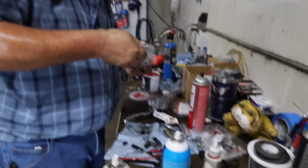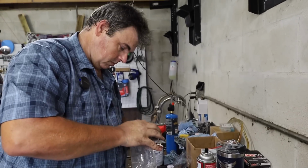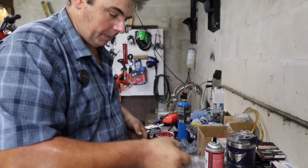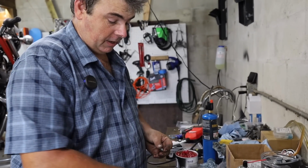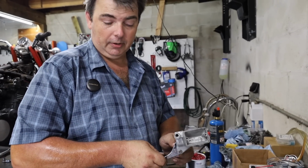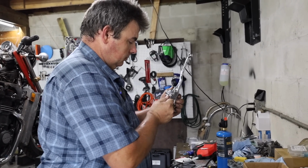Your brakes are progressive, so when they're sticking like that and you don't know exactly how hard you're actually pulling the lever, it really is a problem. It can kind of jump up and catch you unprepared, and you may accidentally be applying a whole lot more brake than what you intended, and if you're pulling into a parking lot with some gravel or sand in it, you're in for a bad day. Especially if you're riding an 80s bike with some spaghetti noodle forks, all right?